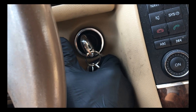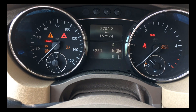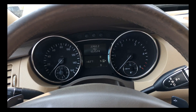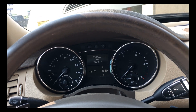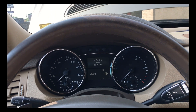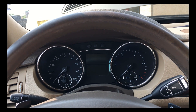You put the key in. This is on a timer, so to speak. Most modern cars are on a relay. I'm going to hit the key and release, and it's going to crank. My hand's been off the key the whole time — it's going to crank for 5, 7, 10 seconds. It's not starting. This is not uncommon with diesels. There are a lot of reasons, but one common reason is low fuel pressure — be it the low pressure system from the tank forward to the mechanical pump. You could have a bad in-tank pump that won't bring up 45 to 65 pounds of pressure. If you don't have 40, 50, 60 pounds of pressure behind the high pressure mechanical pump on the head, this thing is going to have a hard time starting. You also need volume, not just pressure.